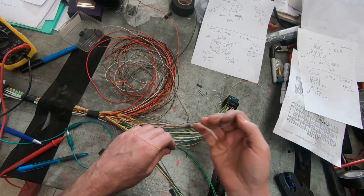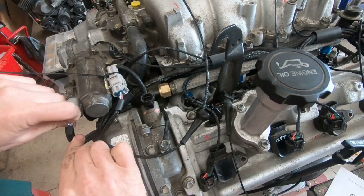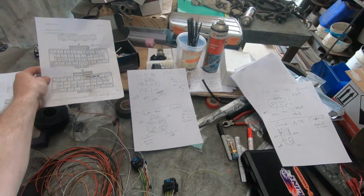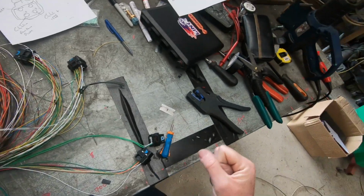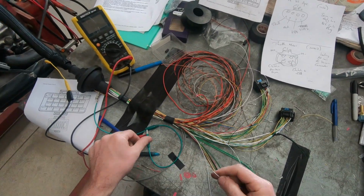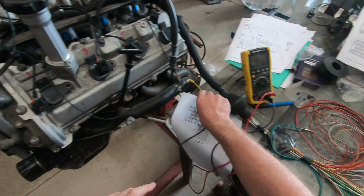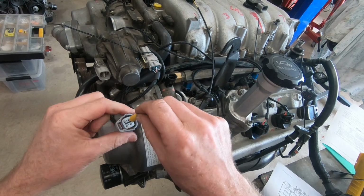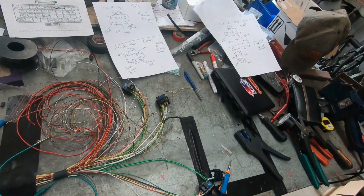Right, I'm steadily running out of wires. Right, that clutch thing. Orange and a white blue. Okay, I've just allocated an auxiliary for my clutch. So this is the throttle motor clutch. As per normal, I do a continuity test. And it's in pin 1, 2, 3, 4. Is that pin 4? Yes, it is.